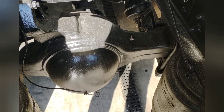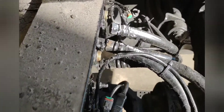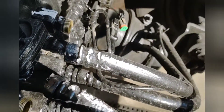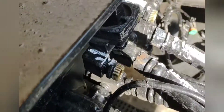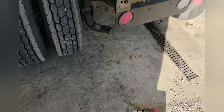Come back when I'm halfway through the job, see how it's going. I've disconnected the hoses — I'll leave all that connected right to the brake chambers. Make sure you mark the hoses so you know which way they go back. There's your emergency and your service, so make sure you mark them. There's only four of them, ain't that hard to figure out, but I marked them anyway. Pulled my ABS sensors off — I'll leave them connected to the back there, pull them off right up here.